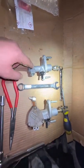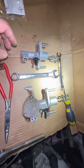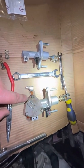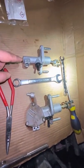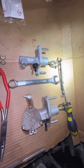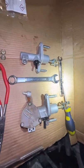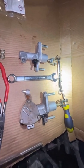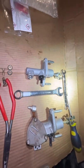From what I've read and been told, the EM2 Civic clutch master cylinders are more durable. They were made to be a little softer on the clutch pedal, which kind of contradicts itself in cases where it gets spongy — but it should be more durable overall. A lot of issues like synchros, bearings, or the input shaft can get damaged internally if the clutch constantly grinds or acts up. So I opted for this as a future-proof solution — the car is almost 20 years old.